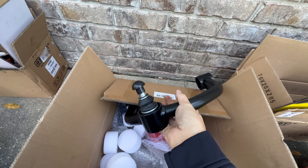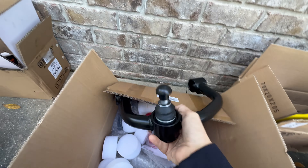In this box I bought some new upper control arms. That ball joint is a lot tighter and it comes with polyurethane bushings. I'll set a link in the description below — these are just bushings you can replace without replacing the whole arm if your bushings are going out. It's got the inserts, new hardware, and it comes with grease fittings on both sides so you can grease each side. Look how much better of a fit that is — it does come out a little bit more, which is better, but I don't want the wheel too far off camber.